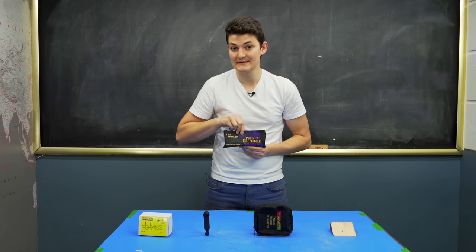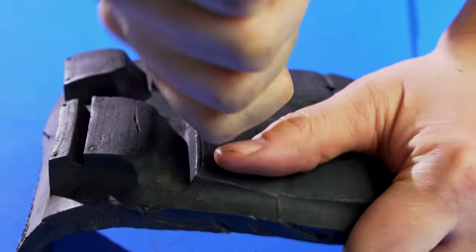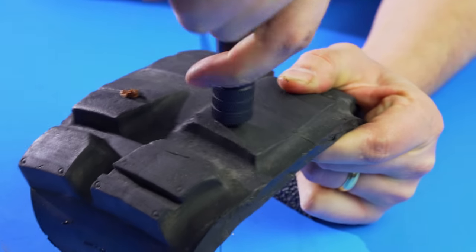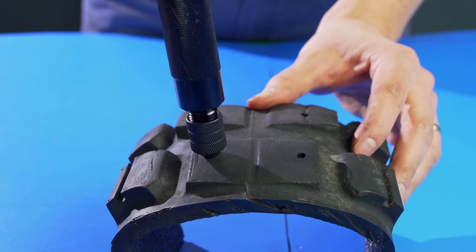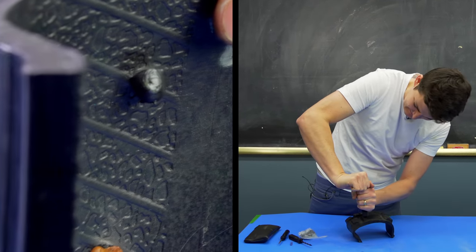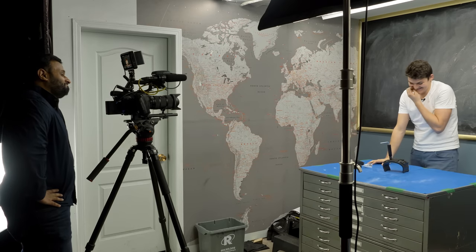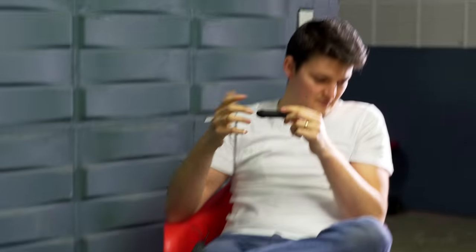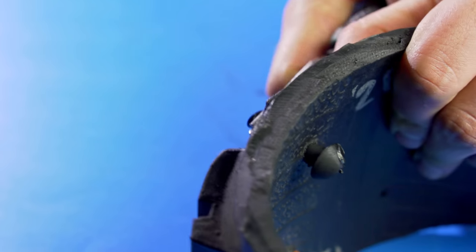Next is the mushroom plug. You have to rasp your hole bigger for this one. Then insert the probe — it's impossible to keep any air in your tire, but never mind. After that, we just load the mushroom into the plugger, attach the plugger to the probe, and turn the hex key to force it through. Mushroom plugs aren't hard to use — the kit is like three extra pieces, plus pliers which you'll need to seat the mushroom against the inner tire.